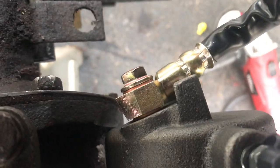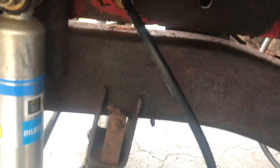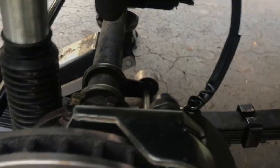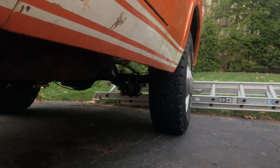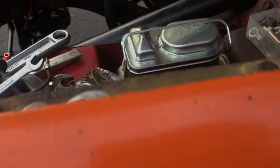So really all you have to do here, as far as installing your brake line, it's a banjo bolt style. So you just have to put a crush washer on the other side of the thing, bolt it down, and there's kind of a slot here where that would sit. And so that gives you a pretty good angle there. And then there's a little boot right there you could slide in case your hose might contact something while you turn, so you could always check that, move it accordingly, and it'll stay in place. Maybe you gotta add a zip tie or something. But that's basically it. And then as far as bleeding, you always want to start at the point furthest away from the master cylinder. So start at your wheel over there, then move to this one, and then the passenger one, and then finally end with this one. And because my master cylinder is right up here, it'll work out the air bubble.